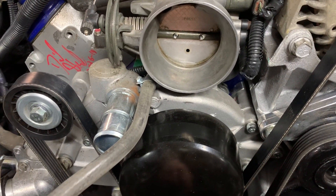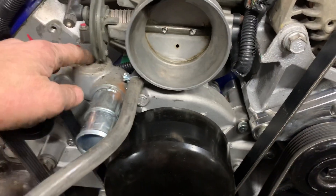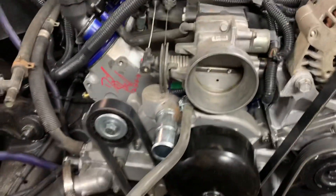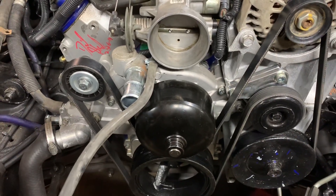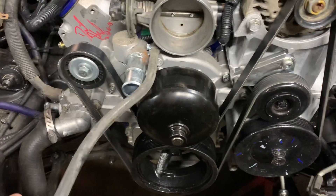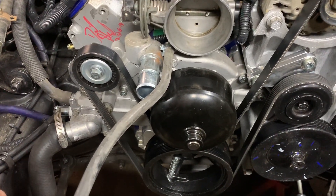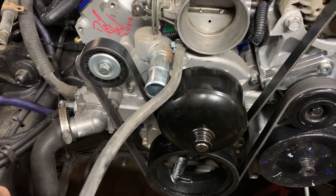You can keep the truck water pump. I've seen some people actually keep the truck water pump and take the tube out of this and drill a hole through the front — just a whole lot of rigging it up. But I just thought it'd be easier to go ahead and change it out for the F-body water pump. That way, if anything ever happens in the future, all you got to do is go and buy a cheap water pump and swap it out. It'll bolt right back up, without having to get another truck one and do all that drilling.